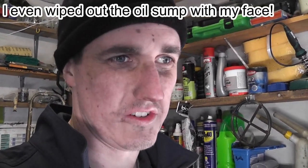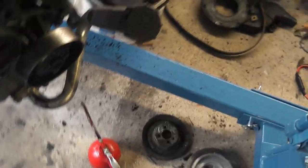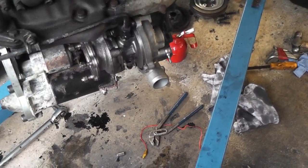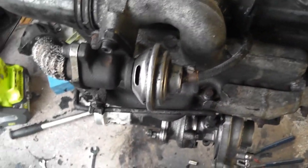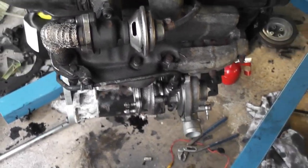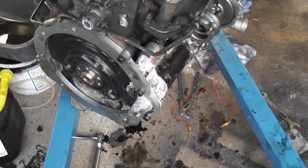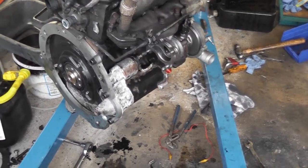I think I've done as much as I'm going to do today. I did accomplish a bit in the end — a lot of the dirty, horrible, oily stuff is done. The oil sump and oil filler are on the new engine. I've cleaned up some of the pulleys and put the water pump pulley back on. The turbo is back on there, and I've installed an EGR blanking plate — that just takes the EGR out of the equation. It leaves it there but it doesn't do anything. They're problematic, and the last thing I need is trouble with EGR valves. I'll go and do some shopping to find the right flywheel. Once I have that I can crank it over, put some oil in it, spin it on the starter to check oil pressure, then start hooking up the electrical harness to see if I can actually get it to start.